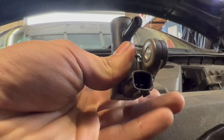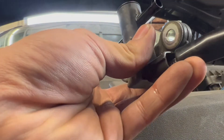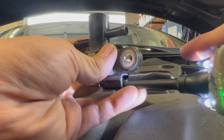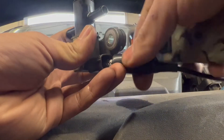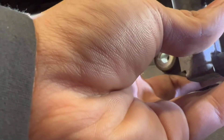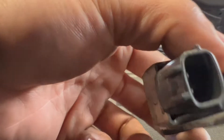I'm using my power probe and putting it on one of the pins. I'm putting power in just to make sure the purge valve is still working. If I put power in, you should hear it click. It doesn't matter which pin you put power on — either side works. You can hear the purge valve clicking, so this purge valve is good. You test the vent valve the same way.